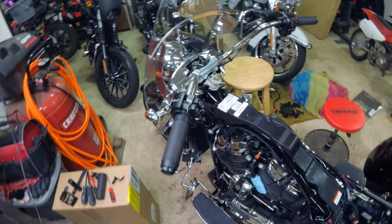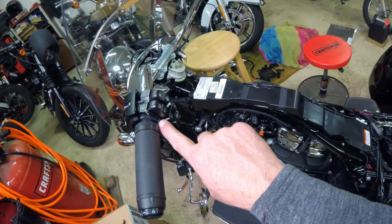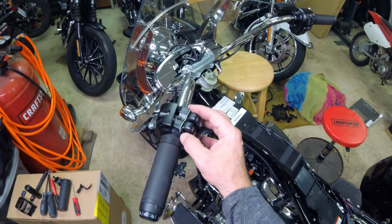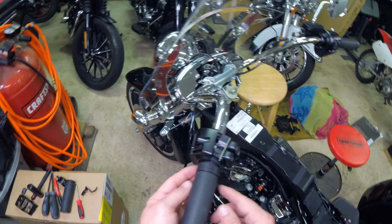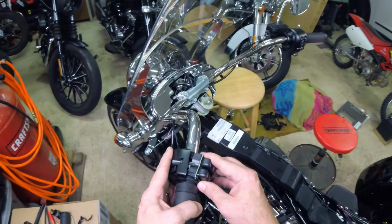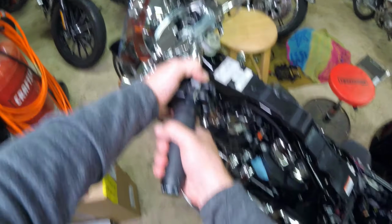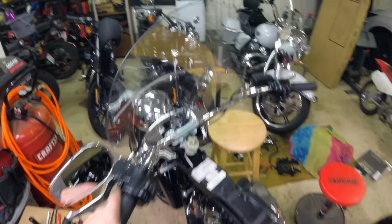Alright, okay, as I'm going back together now, remember, one half of the grip locks into the switch cluster, then the other half, you can actually see a little line right there. The other half is in this outer metal case, the switch housing, and that holds that grip. And then once everything's bolted together, it's super tight. There we are. We have heated grips installed. We just don't have them wired, but we have them installed.